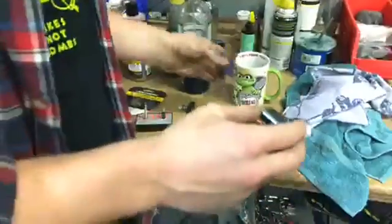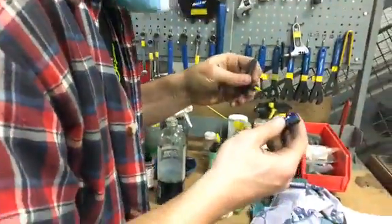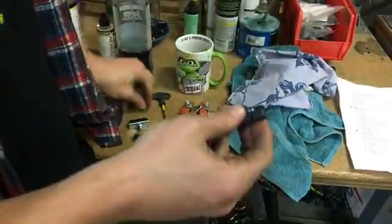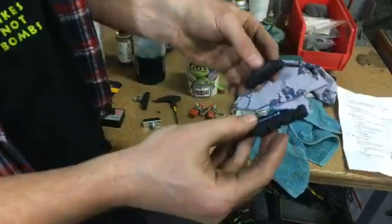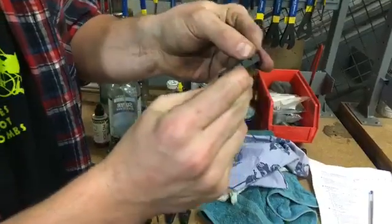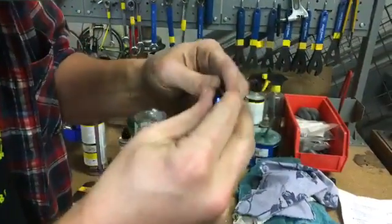So there's different types of brake pads. Some of them have inserts. So for this one, let's see. So it's got a little insert, and I'll do a live demo. So we'll pop this insert out. It's got a shoe and then a pad. And so for these, you don't even need to replace the whole brake pad. These you can actually just replace the inserts. Right, so these also have wear lines. And so when those wear down, you can just grab some new inserts, pop them in your shoes, and then reinstall the brake pad. Let's see. Right, so it looks like that's getting caught a little bit. There we go. Cool. And then we would reinstall that.